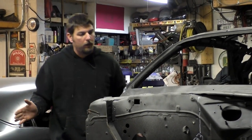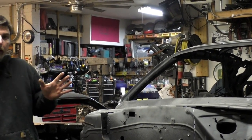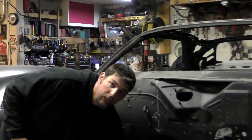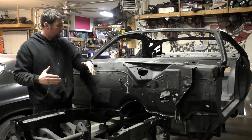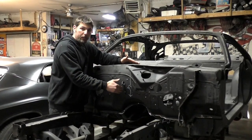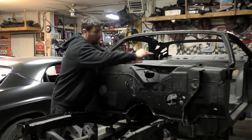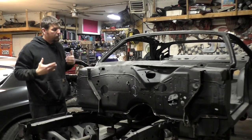I also wrote them in a notebook. Another measurement I took — I went from my frame jig here, which you can go to whatever your base structure is, and I went to the top of the upper cowl panel. That measured 33 inches. Our new cowl panel shouldn't go above that, and that's going to set our height up and down here and our curvature in the cowl, which is also going to set our hood height, so that's an important measurement.